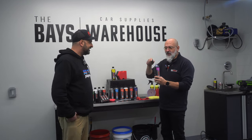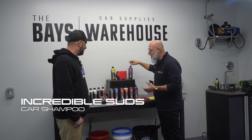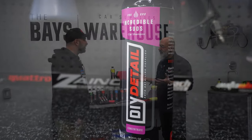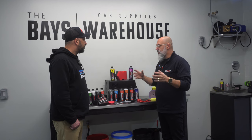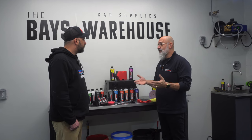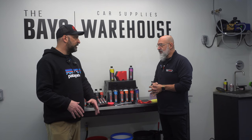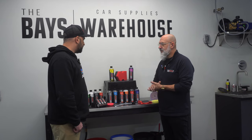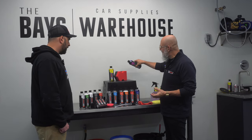This is our Incredible Suds. We named it such because it really does what it's supposed to do — it suds incredibly. In your foam cannon, one ounce or 30 milliliters is all you need for the one liter of water to get thick shaving cream suds with a pH of 8.5 that is actually going to cut through dirt. You can also use it in your bucket for your contact wash. Five gallons or 20 liters of water — one cap full is all you need. It's very much concentrated and it does smell amazing.